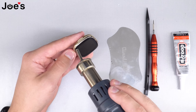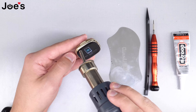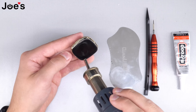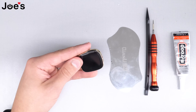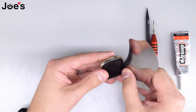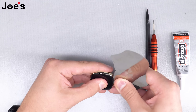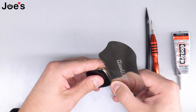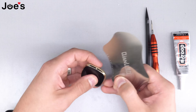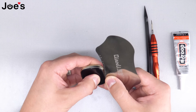Let's begin by applying some heat around the edges, set to about 200 degrees Celsius. Make sure you don't heat too much because then you can ruin the screen. We want to preserve the screen since we're just replacing the battery. I usually like to go to the side opposite of the button, fit your tool in there, and if it's heated up enough it should go in without a problem. Work your way around, and don't go too deep inside because you'll end up ruining the LCD.